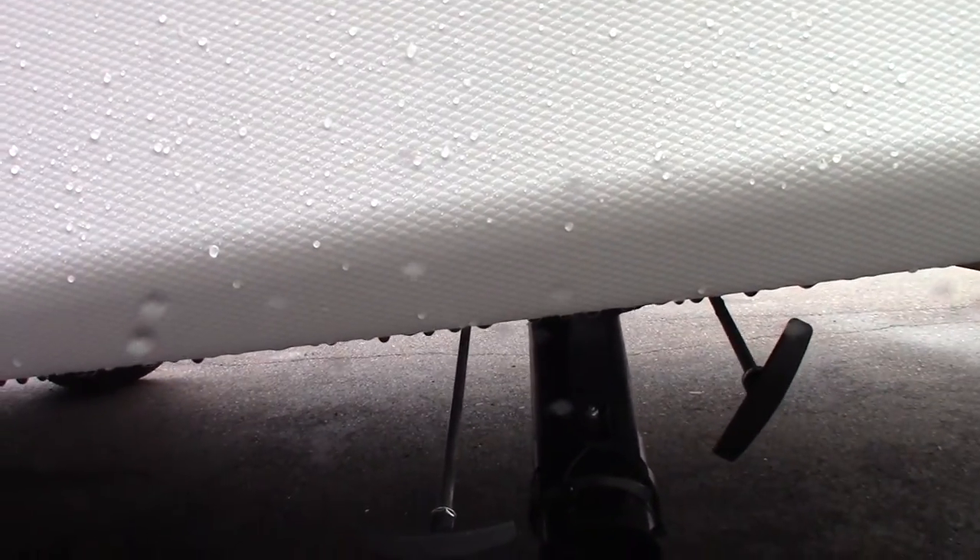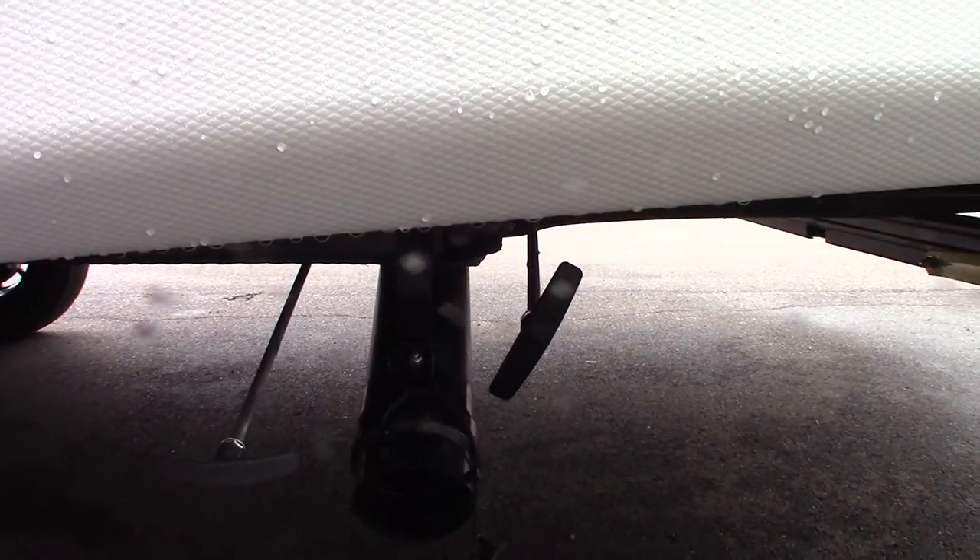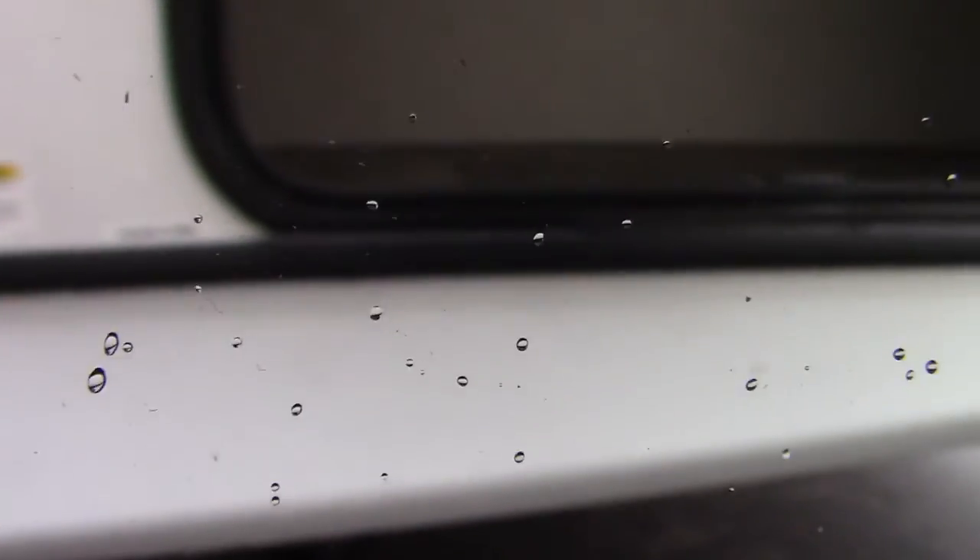You have your gray tank and your black tank here — gray valve for the gray tank, black valve for the black tank. The black tank is toilet water and waste; the gray tank is sink and shower water. Always dump the black first, then use the gray to flush it out. Leave the valve open on the black and put the hose on that flush port to spray the inside of your tank — it'll clean off the sensor so you'll get a better reading and it won't get clogged up and give you false readings.